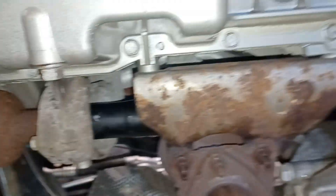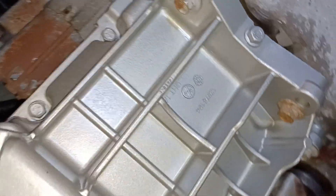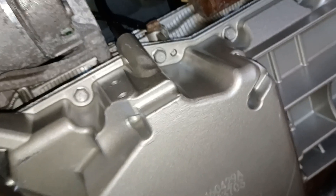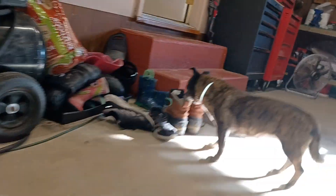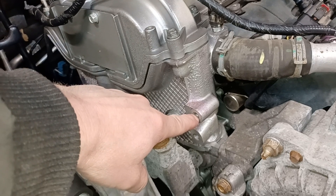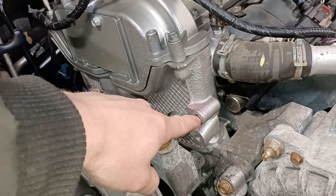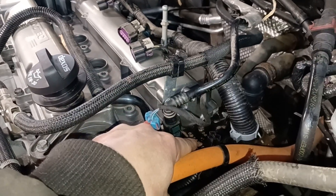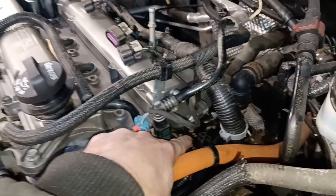I also had to unbolt the jackshaft mount from the block, and then obviously your bell housing bolts, oil pan bolts, and the starter. Once you get all that stuff off, I leave a couple of bell housing bolts in, get a heavy-duty chain with M8 by 1.25 bolts — I bolted in here, chain up and around and over to another bolt hole on the other side. Two M8 bolts for the weight of this engine — figured that was enough.